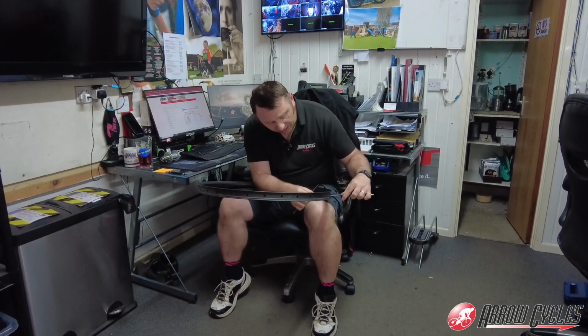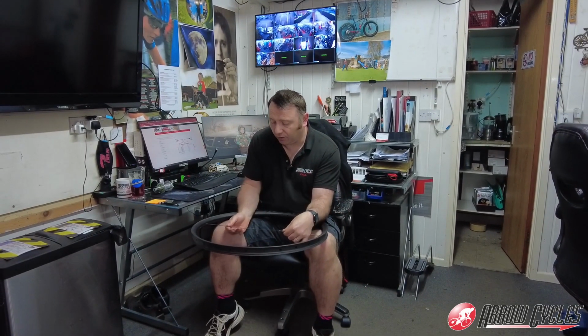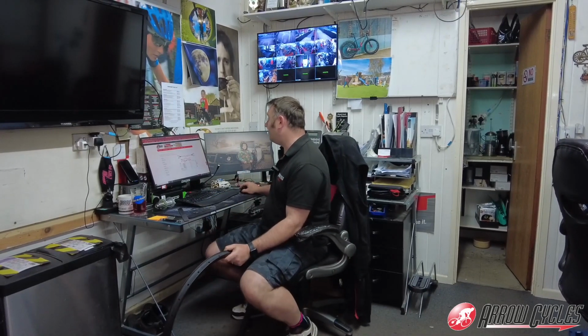So to measure it, we just grab 2 spokes. These are both measured and cut specifically to 200 millimeters. Then you pop the spoke into the rim on 2 opposing spoke holes, and then take a ruler and measure the gap that's left between the 2 spokes. In this case it's 190 millimeters. So with that, knowing that each spoke is 200, 400 plus 190, sorry, so that's 590 millimeters. So we just pop that in on the effective rim.